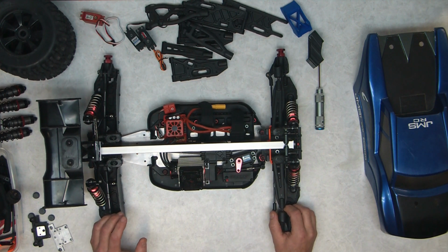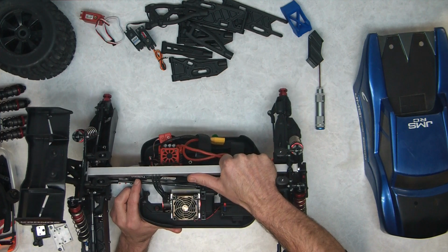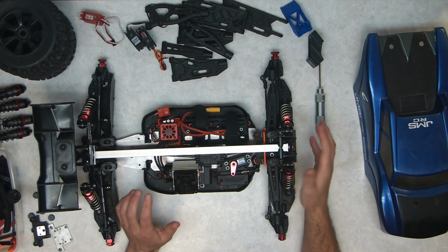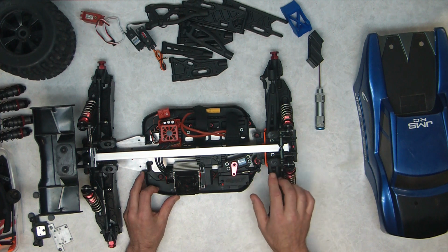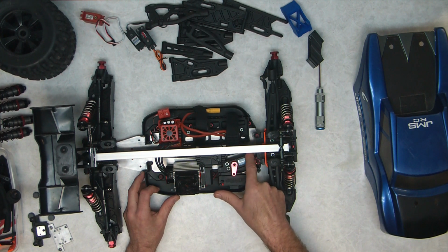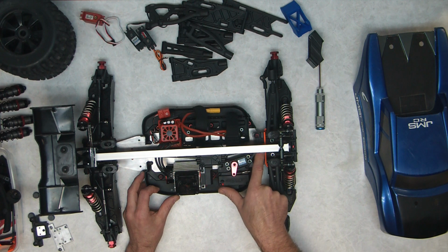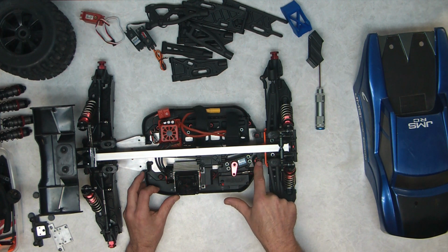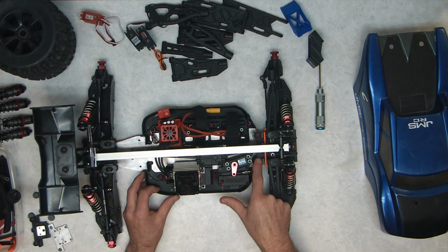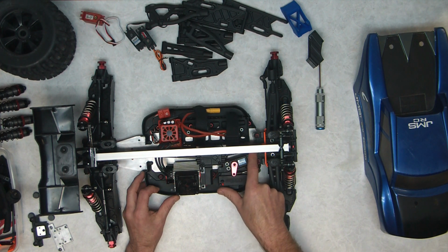The changes I have done are I've added a 7075 optional brace for the rear, because I need to stiffen up the rear somehow in order to take the flex out of it. To get the flex out of the front, it would be easy just to buy the 7075 braces and fit those, but I would have to buy the bottom one and the top one in order to make it stronger. And in my opinion, it doesn't really make sense to have strong braces but still have a top steering plate in plastic or composite. And also, buying the braces, well, they cost money.